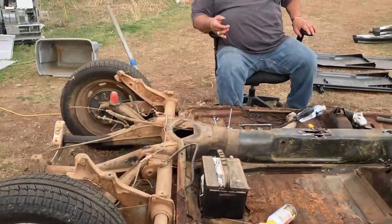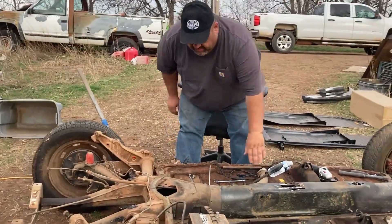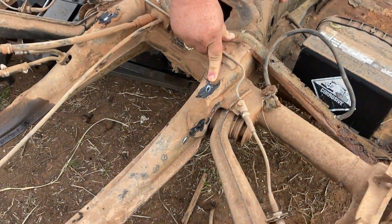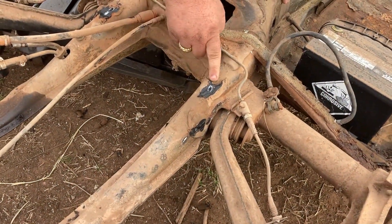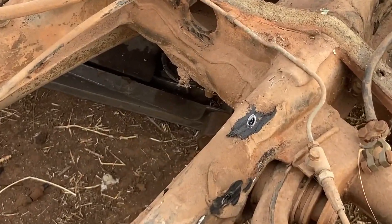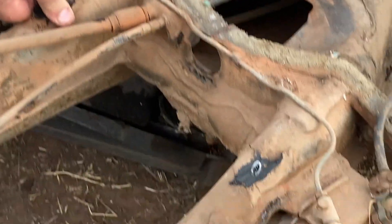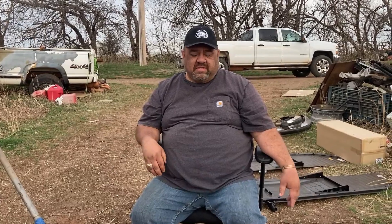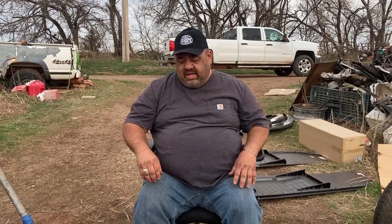I did grind off the heater cable control cable exits — where they would have gone to the heater boxes. This car is not going to have heater boxes; it's going to be an off-road toy. If it were to have a heater, I'd put something like an oil cooler with a blower motor and a flapper valve to control airflow direction.